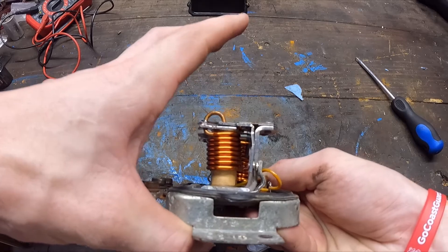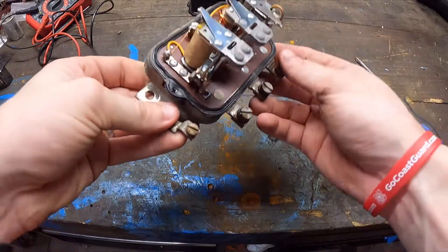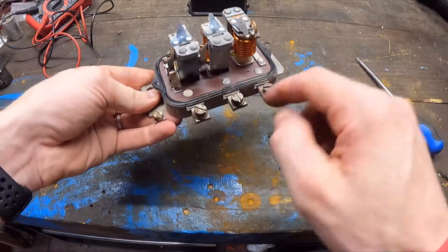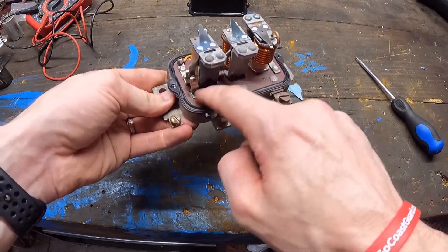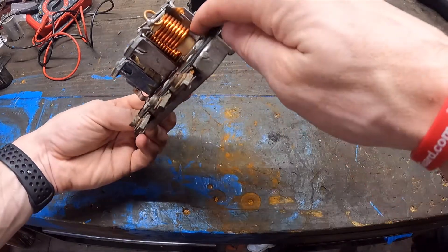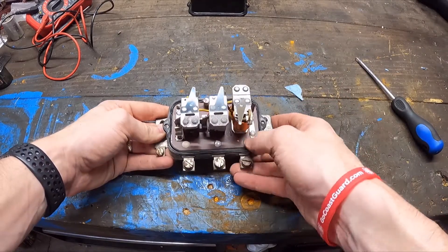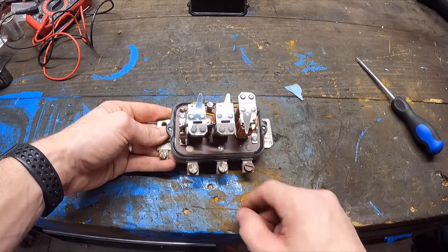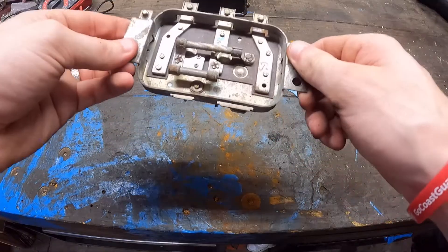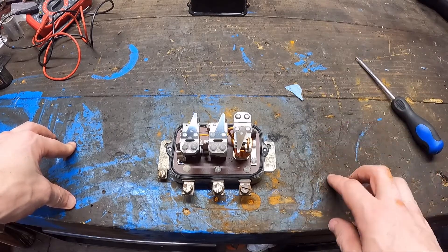That's a very basic explanation of the voltage regulator. All I'm going to do is go through and clean these points. They don't look bad — they don't look dirty or corrosive — but on the bodies there's some corrosion and a little bit where the posts come in. I doubt this has any effect on it, but I'm going to take a wire brush to it and clean it up. Nothing fancy — you guys all know how cleaning stuff with wire brushes goes. I'm going to clean these up, including on the back, and hopefully that'll help deter any future problems.